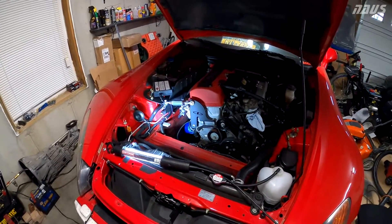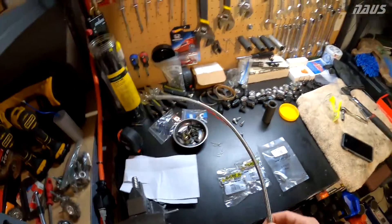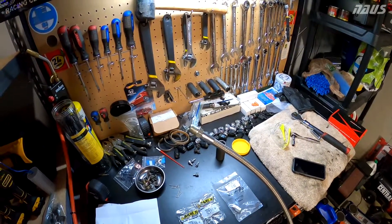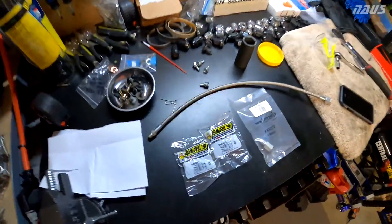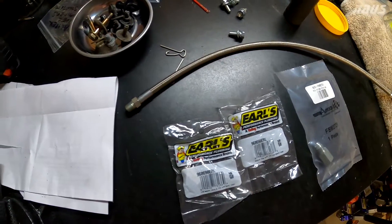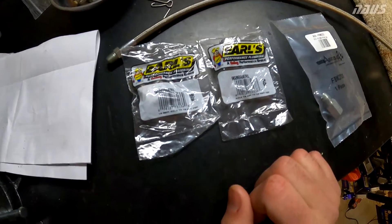The block itself is a female 1/8 inch British pipe tapered thread. There aren't any clutch lines I could find with a 1/8 inch male British pipe thread on the end, because the taper between a British pipe thread and an NPT thread — which is the SAE US standard — is at slightly different angles, so they're not going to seat perfectly to each other, and it's a potential risk if you thread them into each other. So I wanted every connection to be as designed.